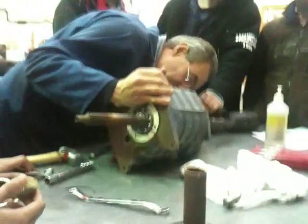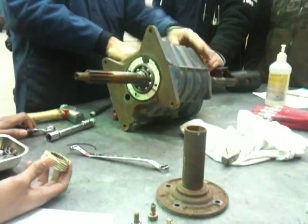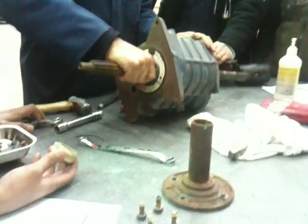Second hand, a good one - you're probably paying $400 or $500 for a second-hand one. So what I'm going to do now is stand it up, and get this lay gear to drop down into the bottom of the gearbox. I've actually pushed it down into the bottom, and once I've done that I should now be able to pull the input shaft out.